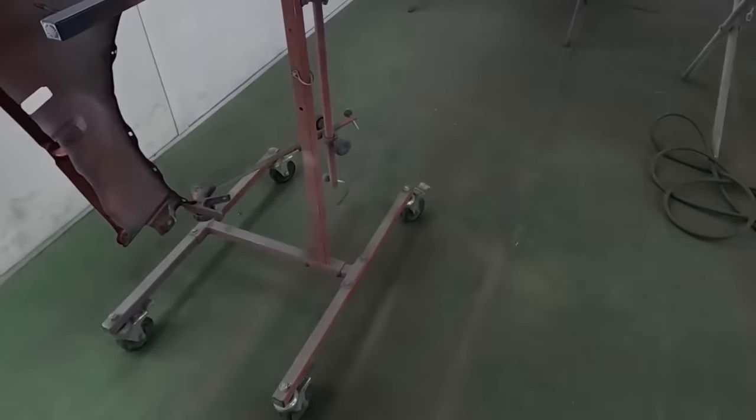Over here on the passenger side door jamb, same exact thing. You can see we've masked up all the areas that we want to and ran our fine line. You want to run your fine line last so you can pull it off first. And we have all of our jambs completely taped up. And this is the back masking that we were talking about on the driver's side. You can see how it's stuck on pretty much upside down or backwards. And once we close the door here, we can tape on top of it with our masking paper and get a nice clean seal all the way through.